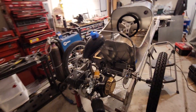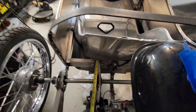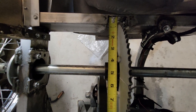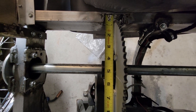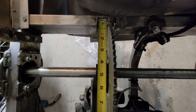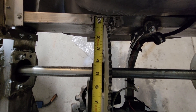Quick measurements — I'm going to try to help out my good buddy Mike Kelly. My crossmember in front of the axle is four and a quarter, centerline to the back of that crossmember, and that clears a 75-tooth, 35-pitch chain.